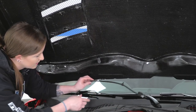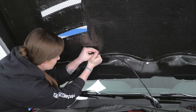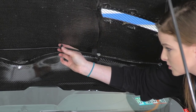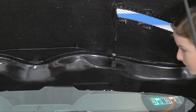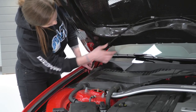One of the last things we have to do is reconnect our fluid line. We're gonna bring this up here and snap it back into place on both nozzles. As you can see, there's nowhere to clip our line into, so we're gonna tuck it further down into the car just to make it a little bit cleaner. You have a couple different options with this — you can also remove these clips with a flathead screwdriver if you wanted to.